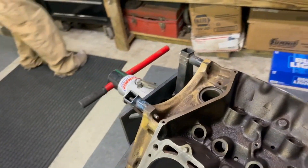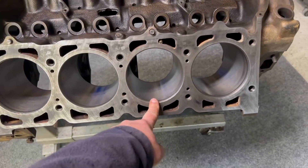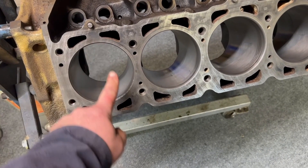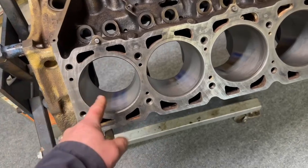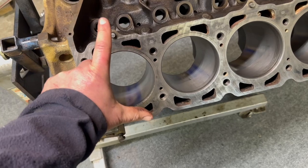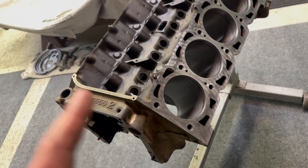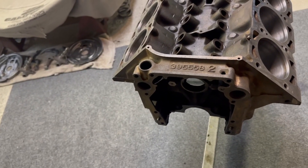So what we got accomplished here tonight — Joe's going to have to work with some real magic on this video — is we miked out some cylinders. We're basically saying yeah, we're a little overboard on some, we might be a little under. This is really the thrust sides of the cylinder — the maximum and minimum thrust because the crank is spinning this way. So we know that if a cylinder is going to get egged normally, it will get stretched out top to bottom, not left to right. What we have is some cylinders that are a little out of round. We're not veering off our course. We've miked out the crank — we're not ready to put it in. We're trying to keep you guys posted on what's happening in short little increments.